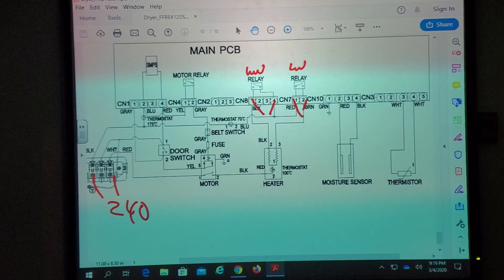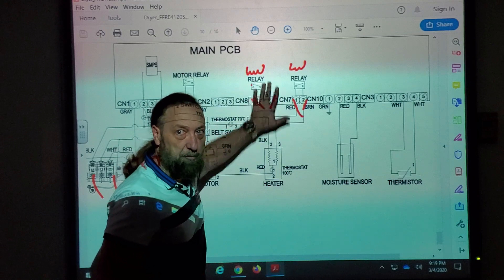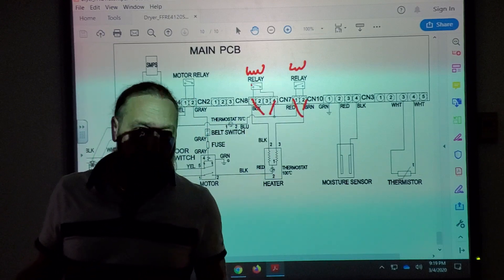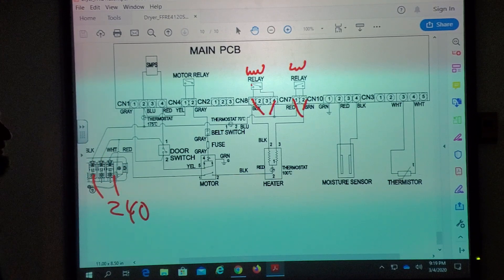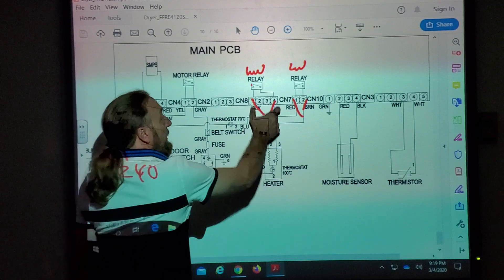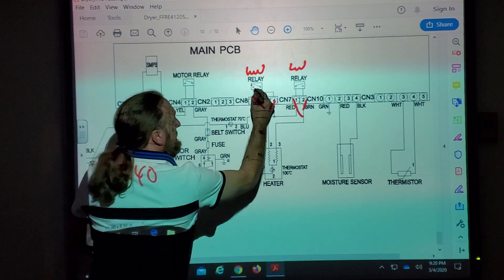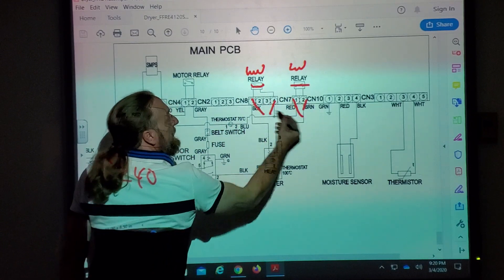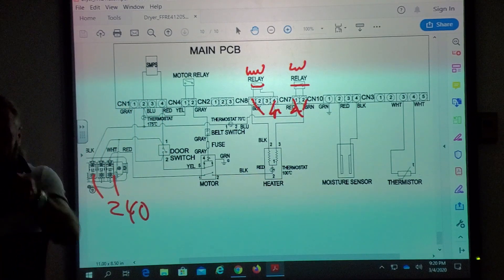You do an ohms test — but don't just take this and check ohms on any board. You have to know by looking at the schematic. If I unplug it, there's no other wires going to that switch, so nothing else can put power there — I'm not going to hurt myself or the meter. Don't go to another brand and do this same test unless you understand the schematic. You unplug this, leave the other plugged in so the board runs and closes those switches, but there's no power because we disconnected these connectors.